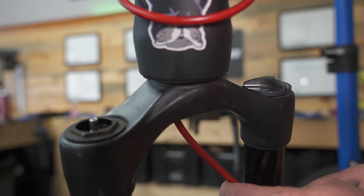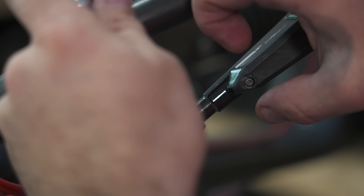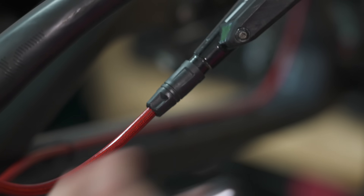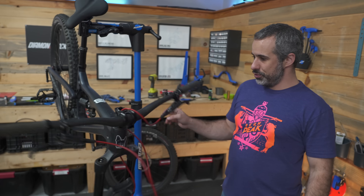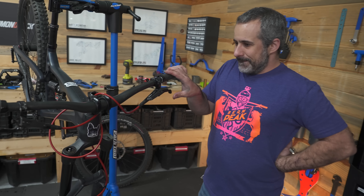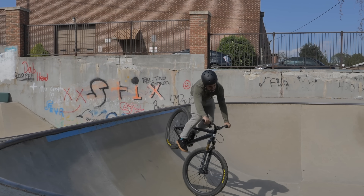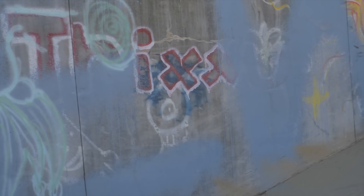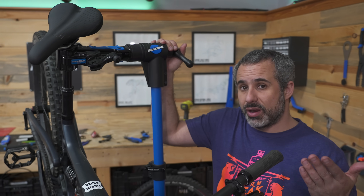This bike originally had a one-up EDC in it. We took it out and we're just going to run the cable through the hole that goes all the way through — then we'll be able to spin the bars around as many times as the cable will allow. Next up, seat post. On a slope style bike you're not climbing hills or riding long distances, so the seat post just remains really low — perfect for jumping. The most important thing is reliability, so there's no dropper post or anything like that, unless it's Kevin's slope style bike — he put a dropper post in his.